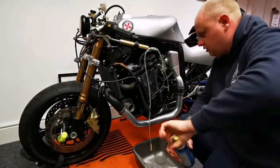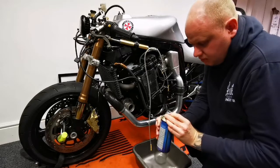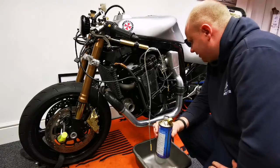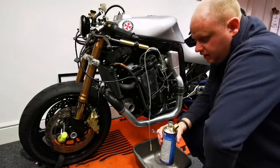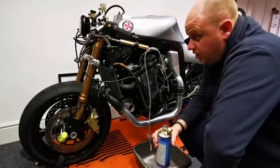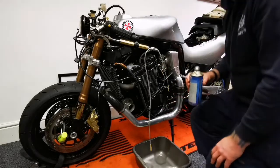Right, let's get on with bleeding the clutch — I'll be using the new racing clutch fluid. I'm hoping with this we don't get the boiling issue I've been having. The clutch in this bike would pretty much do about three runs, and after three runs I'd need to bleed it again. Underlying there's more than likely an issue there, however the clutch works fine, locks up fine, no other issues — it's just a matter of boiling. So we'll start bleeding.